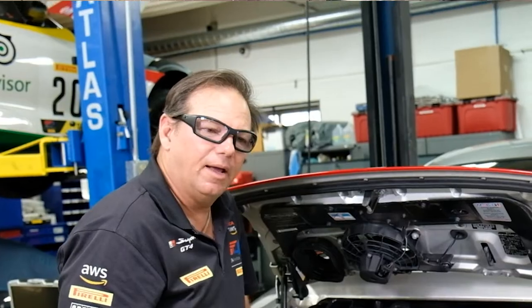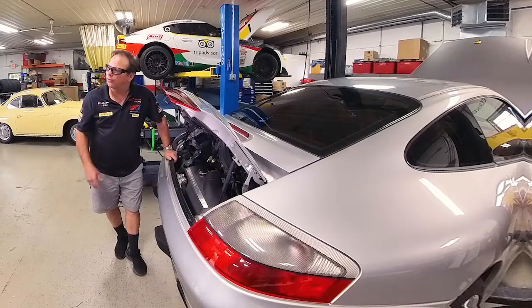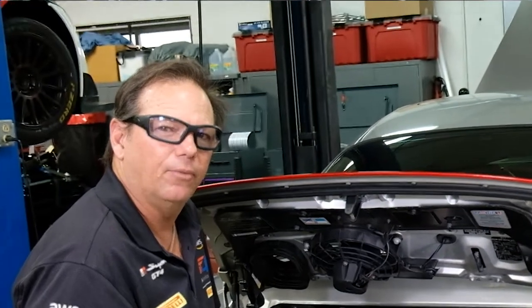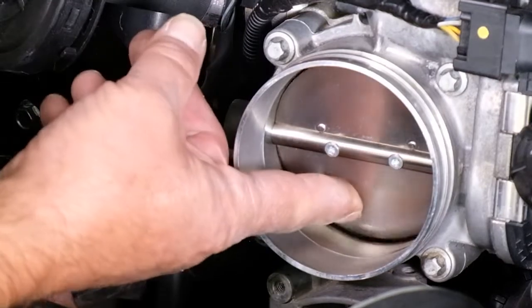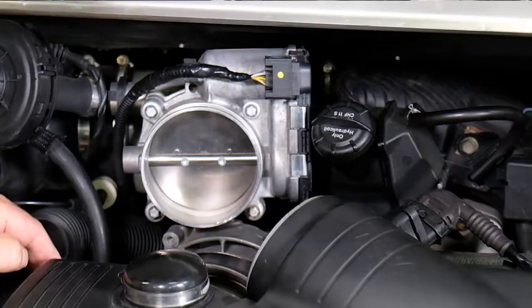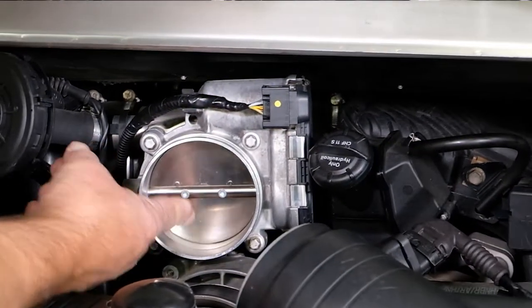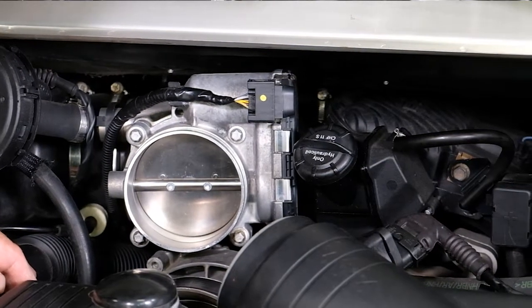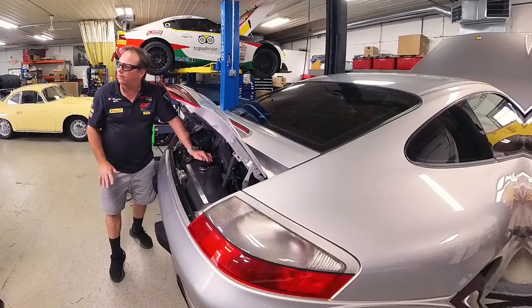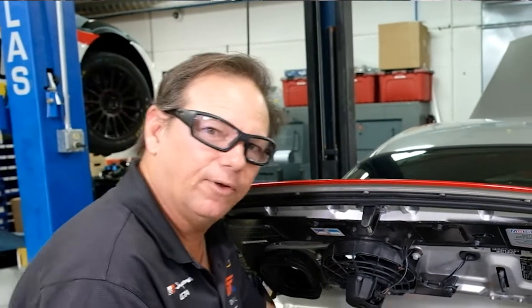The 1999 911 had a throttle cable. The 1999 C4 had an electronic throttle body, and 2000-on 911s all had electronic throttle body. So it's the cars with the electronic throttle body that you want to clean. One of the most important things: when you open it, do not let it snap shut because it can damage the electronic throttle body. Do not let your fingers get in it. If the key is on, turn it off and put the key in your pocket, because this can be very dangerous to operate. There are many items that can damage your fingers if you're working on a modern car — please be careful.